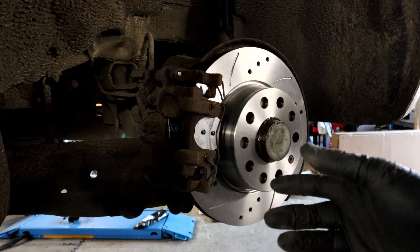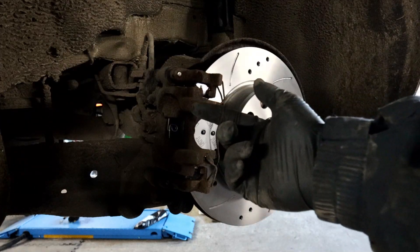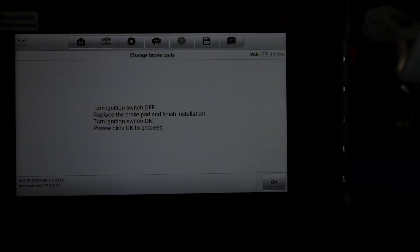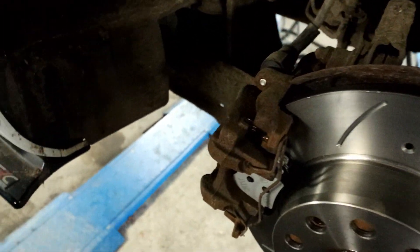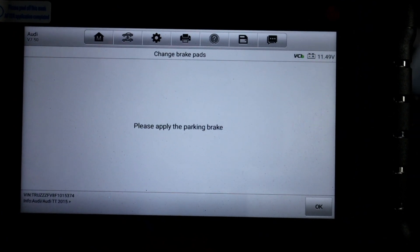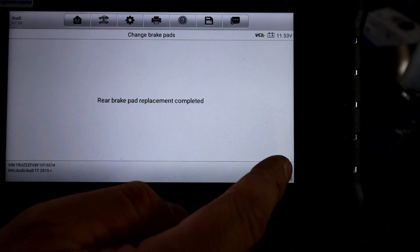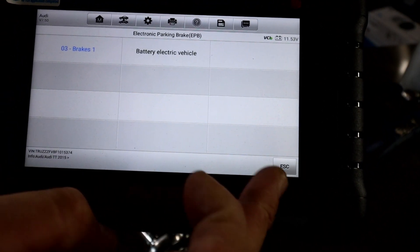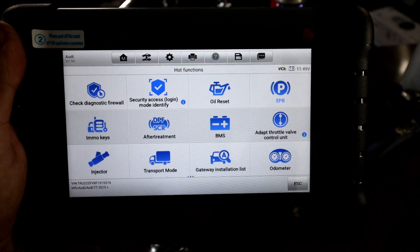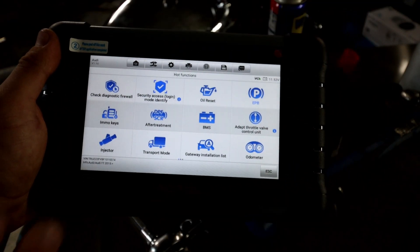At this stage all you have to do is check your brake fluid level, turn the ignition back on, and release the handbrake mechanism using the diagnostic tool with the procedure. You should hear it winding out and that should go back in place. The ignition is back on — press OK. That's doing its thing, and it should come up: please apply the parking brake. So now you have to get in the car and apply the parking brake. I've just turned the handbrake on inside the car. Press OK. There's your final message: rear brake pad replacement completed. Then go back and check if you've got any fault codes, which you shouldn't. But bear in mind — only do this function once you replace both sides. I've just done it now to show you. The other side is exactly the same, so do it when you replace the other side.